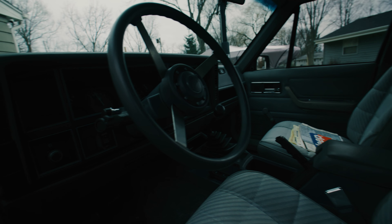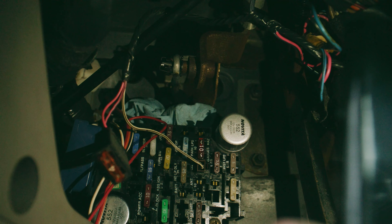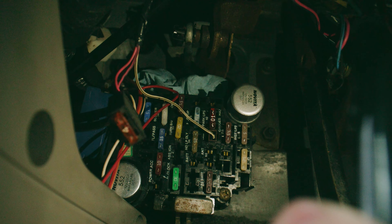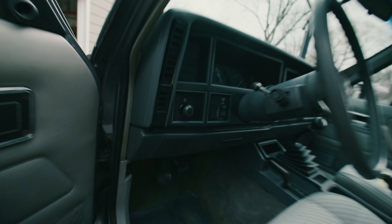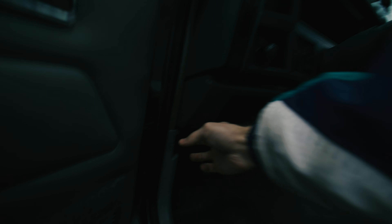The four-wheel drive works great and the transmission shifts smooth. The clutch actuator reservoir is leaking a little bit of brake fluid onto the fuse box, which is really bad. I stuck a paper towel there for now — I haven't driven it much yet, so I'll see how bad the leak is and then just order that part since it's pretty inexpensive.